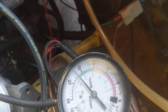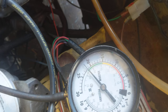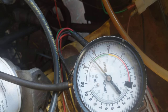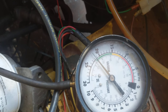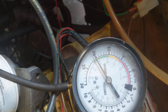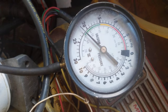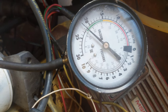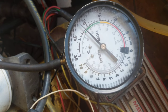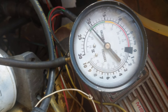As you can see it went to 20 inches, which is still not correct but it's better than before. Because of the emulsion tube I put in here, it needed a little extra adjustment and I finally figured it out. So that's 1500 RPM and I get 21. That's 2000. 3000.